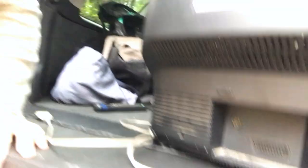So it's 21 inch with SCART input at the back, as is standard here in Europe. This is my second pickup for the week. I also have the other 14 inch Trinitron I picked up earlier in the week and I'm having some issues with that — the geometry is a bit rough. Also it's not responding to remote commands. I use the proper remote but nothing shows up on the onscreen display. Even if you hit volume, you can hear it going up and down but nothing is displayed. Even hitting menu doesn't work, and you certainly can't get into the service menu.